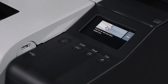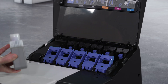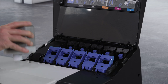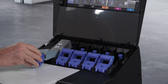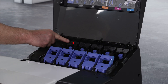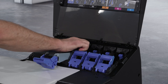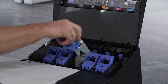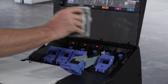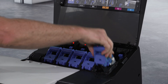When prompted by the control panel to install the ink, follow these steps. You can also follow the steps on the screen. Open the ink tank cover. Bring over each ink tank and prepare them for install by giving each ink tank a gentle shake as shown. Pull each ink tank lock lever toward the front of the machine. Insert the ink tank into the corresponding slot. Each ink tank is keyed to prevent the wrong tank from going into the wrong place, and each ink tank must be installed to move forward and complete the installation process. Gently lift up the lever by the handle and lower the ink tank into the housing and push down to lock the ink tank in. The solid red light will indicate that the tank is installed correctly and that each tank contains ink. Once each ink tank is installed and locked into place, close the ink tank covers.